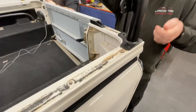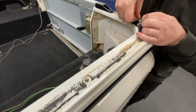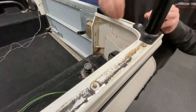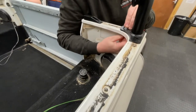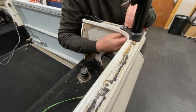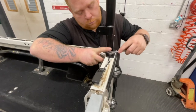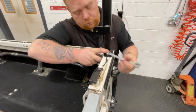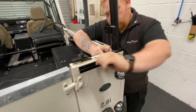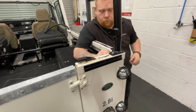The bar is secured using an M8 by 30 hex bolt, with a washer top and bottom and a nylon nut underneath. You'll find all the nuts and bolts in the fitting kit that comes with the bar set. Using a 13mm spanner and socket, tighten up the nut and bolt, and repeat that on all four bolts.